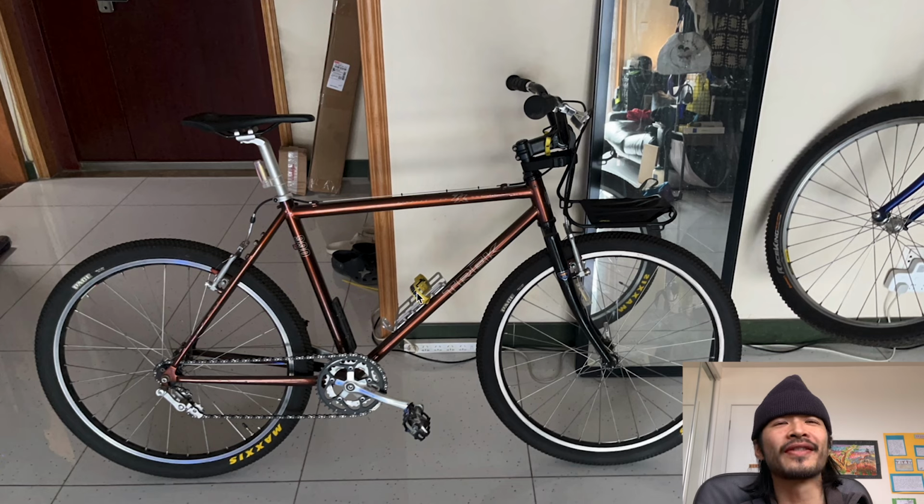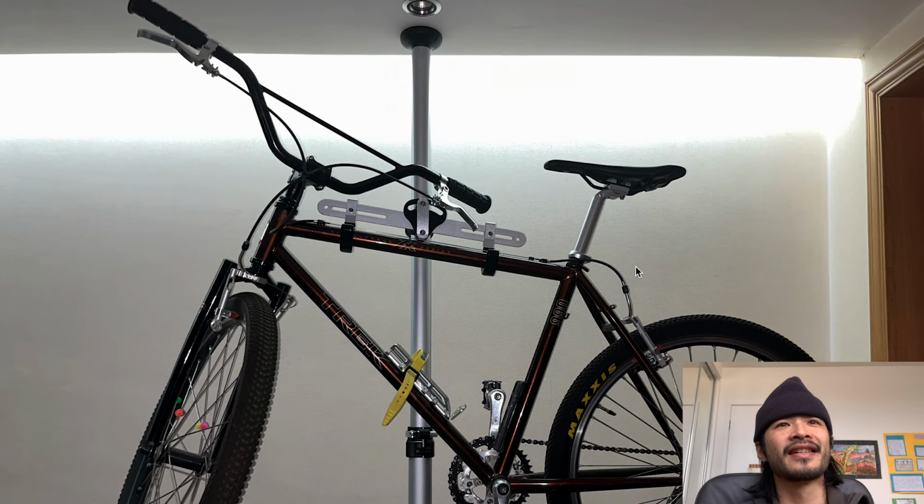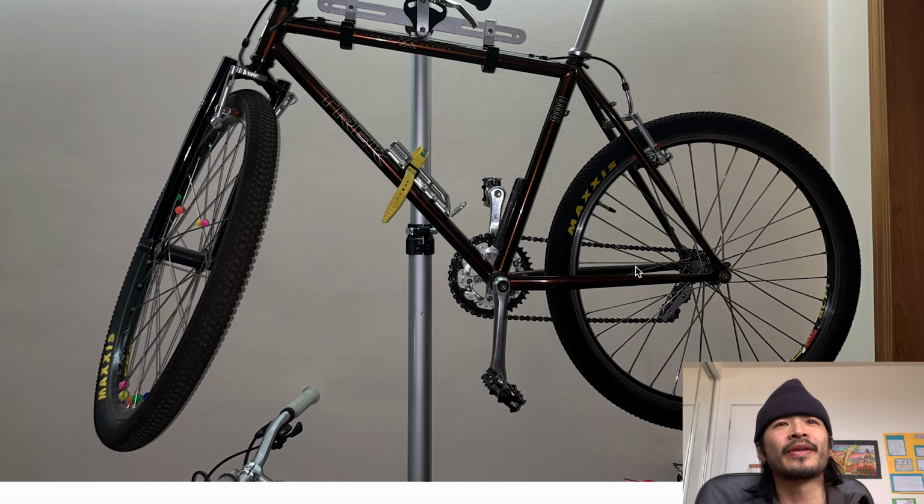Overall, I'm gonna roast you for no bottle in the bottle cage, no horizontal crank, and it seems like your chain tensioner here is a little bit long as well. I think you can shorten up the chain and have the chain tensioner sit up a little bit more. Brake cable's too long here, and then here he's got his bike up on a stripper pole.